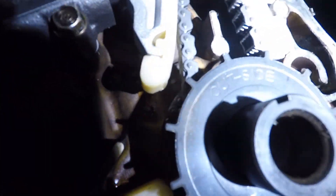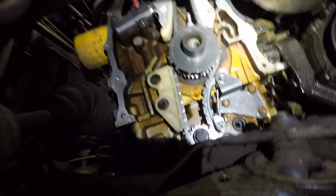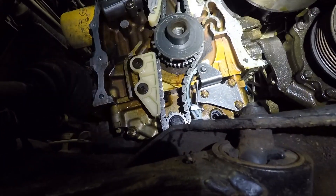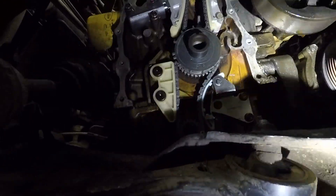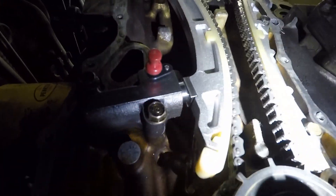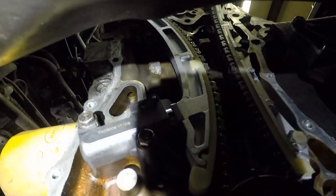You can read the words right there — it says 'outside' on the outside of this. When you install the timing cover, the crankshaft position sensor goes in the cover and that's what it reads, so it knows where the crankshaft position is. The last piece you do before all that: once you finish all this, pull this red pin out of your tensioner — the red pin is out — and now the tensioner can take over and put tension against the timing chain.